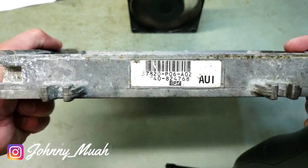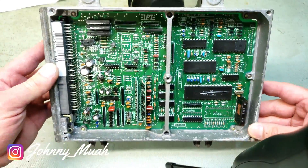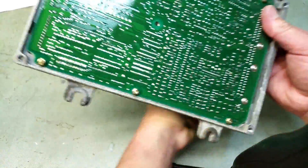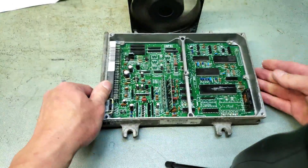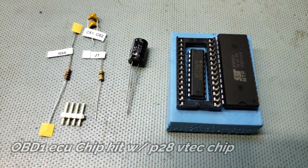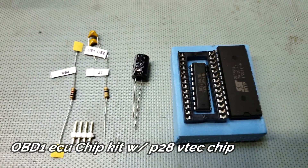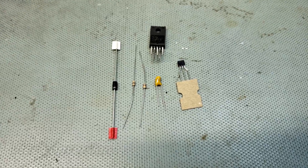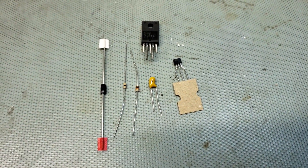What I have here is a P06 ECU which I am chipping. I am also adding a VTEC conversion into it, so if you have a VTEC ECU you can skip that part. I went ahead and took the front and the back cover off. What came with the kit is this OBD1 ECU chip kit, and I also bought the P28 chip. This right here is the VTEC conversion.